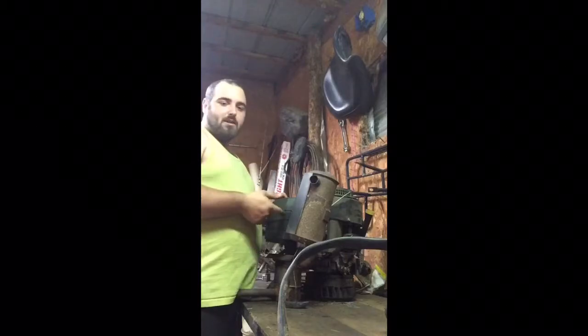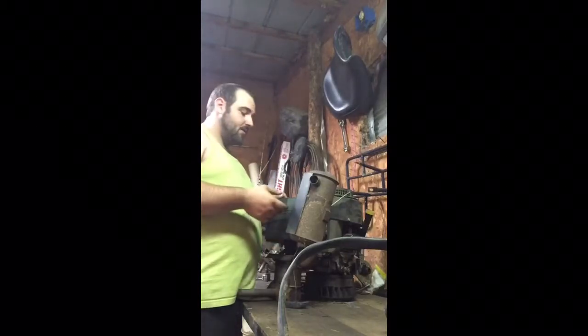We've got a rear pulley on the bottom of it that we've got to pull off. So y'all will be seeing how to properly take off a seized pulley from a crankshaft. And then from there on, we're going to take out all the stuff that we don't need for the application of this mower. We're also going to be doing a needle bypass, and I'll show you how to do that.